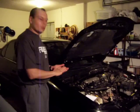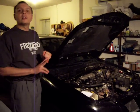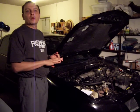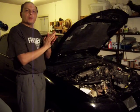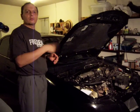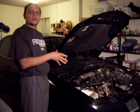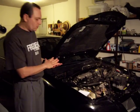For the cars that you want to convert to electric, there are several things to consider. The car has to be standard, fairly light, and sturdy. It has to be standard because the engine adapts and matches exactly with the transmission. You don't want an automatic because the automatic has to be running continuously, while the standard can stop when the car is stopped — and it drives like an automatic. So the standard car is perfect for converting.